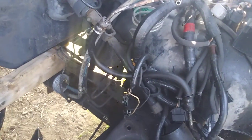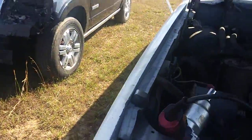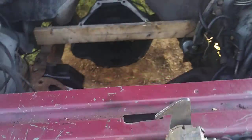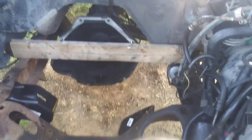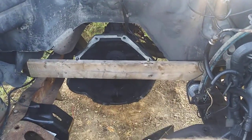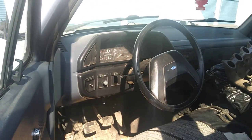I'm not running the new-style pulley setup. We should have plenty of clearance from the radiator support and fan. We're going back to the old V-belt setup — basically how this would look in a 1970s F-150 with a 302. The five-speed transmission won't be affected at all. It doesn't need a computer to work, and the speedometer is mechanically driven on this truck, not electronic.